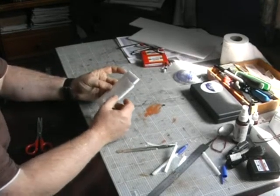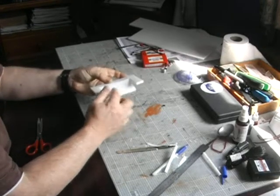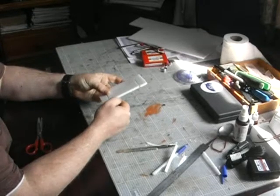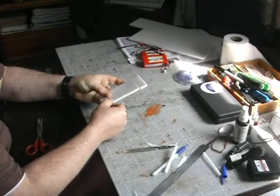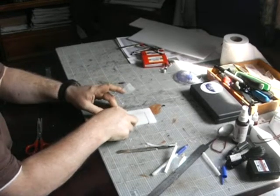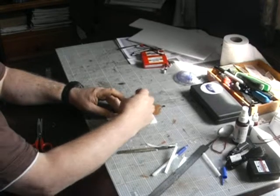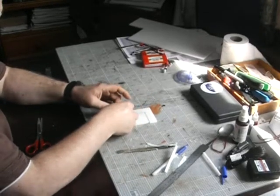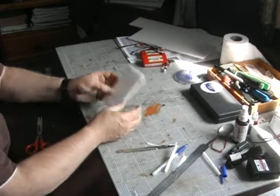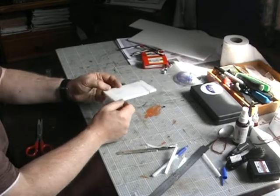If the wings are already on your aircraft and you're having to do this, you can see that it can be a bit awkward to hold them level. What I suggest you do is put them in a level position and put a pin in just to hold them shut, or to tape them here and here, because this is the edge you're interested in. You want this edge up nice and snug with a gap either side. And put your tape on, and basically I haven't finished it, but there's your wing and there's your aileron.